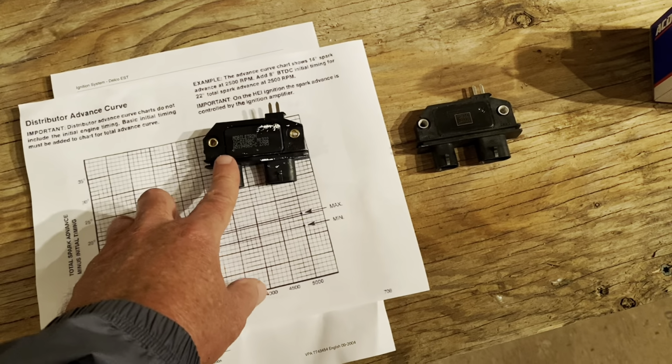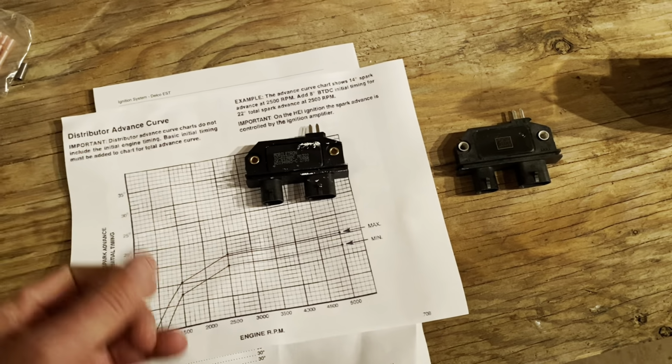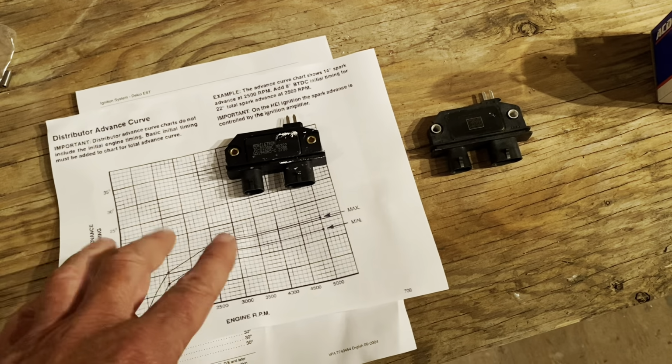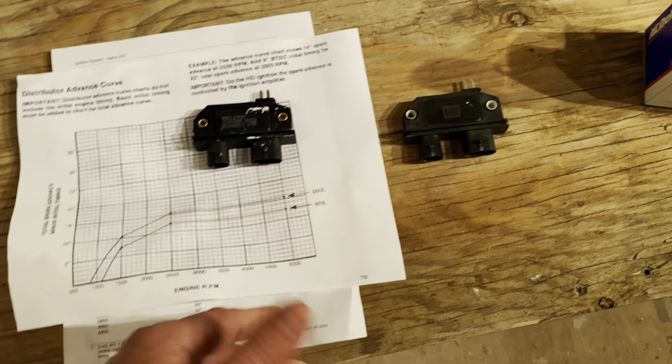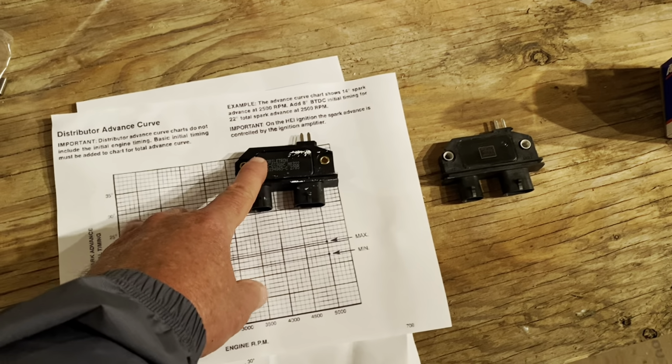I don't think they have it anymore, but back then, if the digital logic side of it died, the chip died, it would revert to an analog fueling system, and the module would take over ignition on its own. It wouldn't even have to have the computer connected to it. And that was what's called limp home. So you really shouldn't use this in a boat.